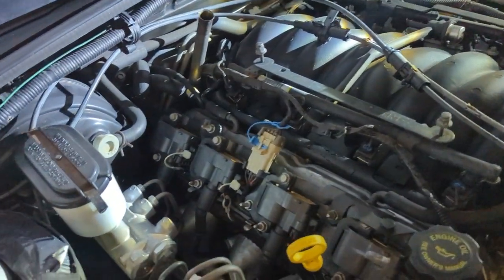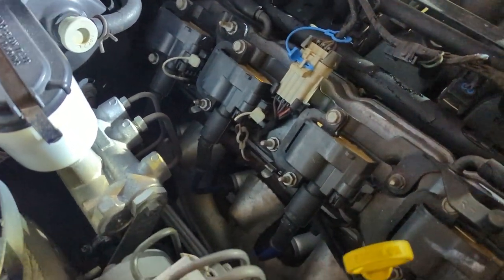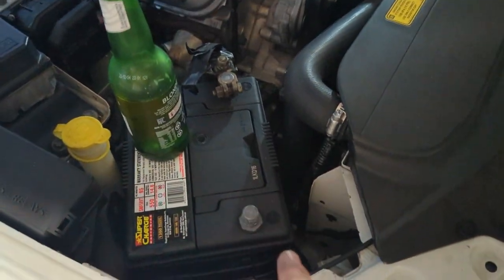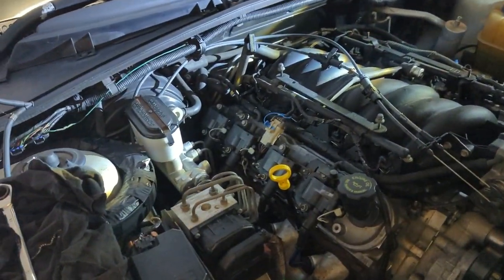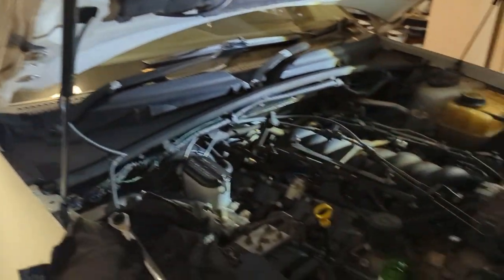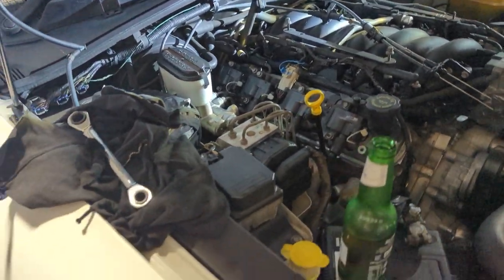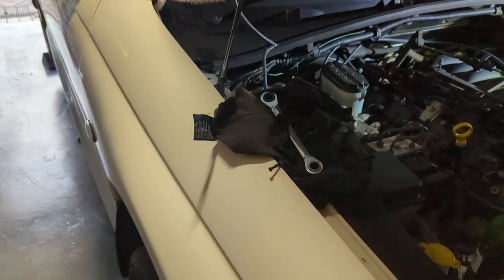Fluid's topped up. I took six litres out so I put six litres back in. I'm putting the dipstick back in, topping up some other essential fluids in Grouse Garage. Got to connect the battery back up — I'm hoping it hasn't gone flat whilst I've been working on the house and ignoring X Popo. We'll connect that back up, then I'm going to jump in and fire it up while it's on the axle stands, put it through first, second, third, and drive, and see what happens. That'll also get that clean fluid through the filter and through the transmission.